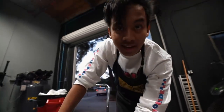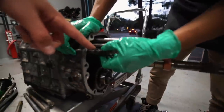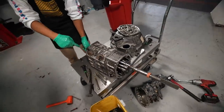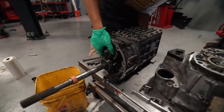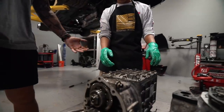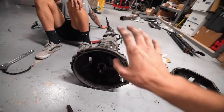Another thing fell out — I heard it — and there's a second dowel pin now too. At least we figured it out, we didn't end the video without an answer even though it took hours. Two pins dropped inside, so we're going to open it up and pick them out. Meanwhile, I just put the bell housing on the new transmission and swapped over the push-pull conversion for the slave and all that. The shifter bushing is missing from the tail end since ours exploded and this one was cracked, so it's not in there at the moment.